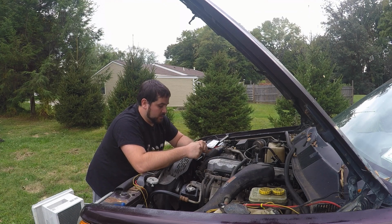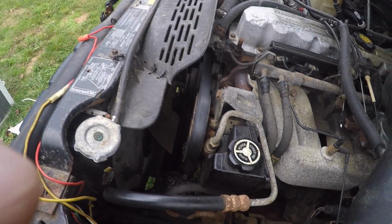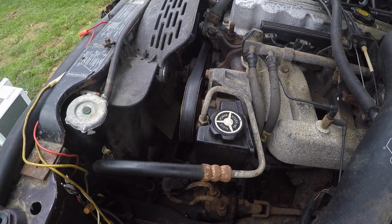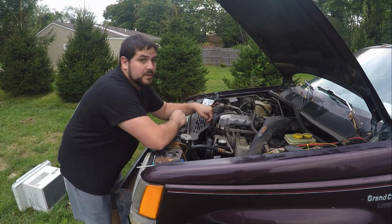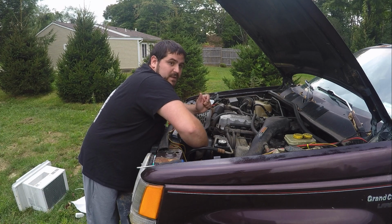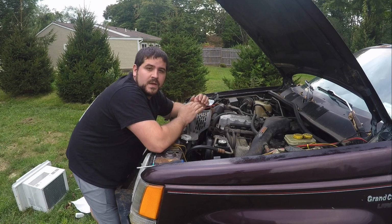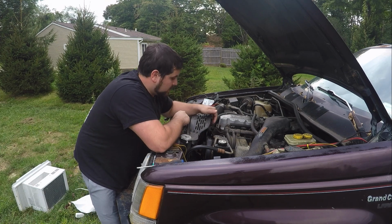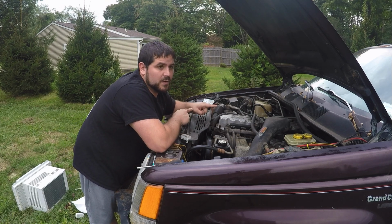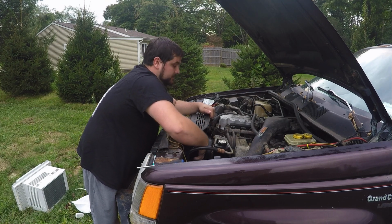But I ended up going with the HD clutch fan. Now I'll bring you over. You can see it down there, the shiny one. That is the new clutch I put on. The reason I put that new clutch fan on is because my old one was failing. A quick, easy way to see if it's failing is you pull it up and down like this, and you get almost no resistance. Almost no resistance means that your clutch is no longer engaging to turn the fan, because that's directly connected to the water pump, and the resistance is the clutch grabbing on the turn of the water pump.